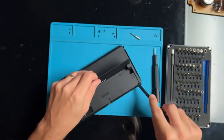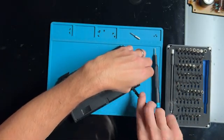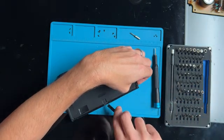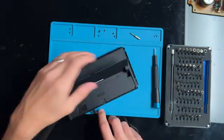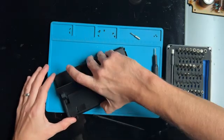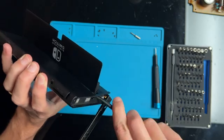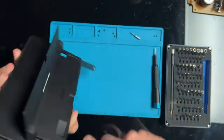I don't understand that other than they just like to make it a pain to open these things up. But with those screws removed, you can pop off the back plastic cover. I use a little plastic spudger to not damage the case — you could probably get away with a credit card or something like that. It was a bit harder to remove the case than I thought it should be, but with some care and time it should pop off.